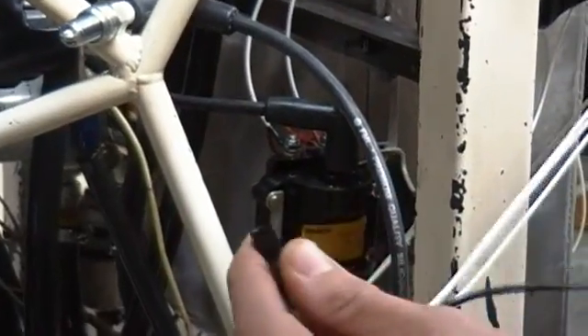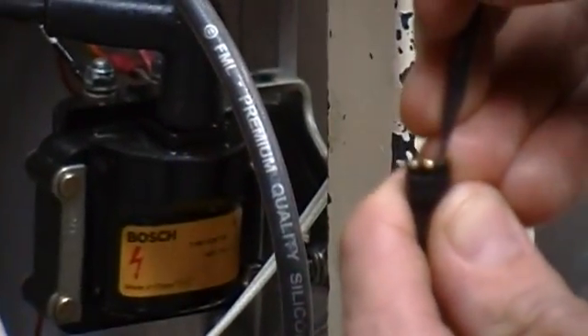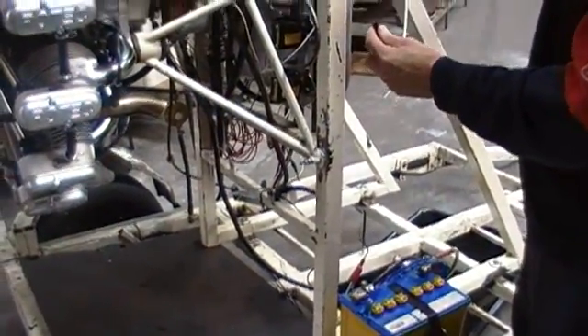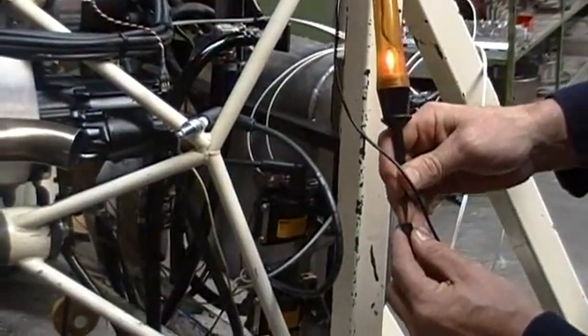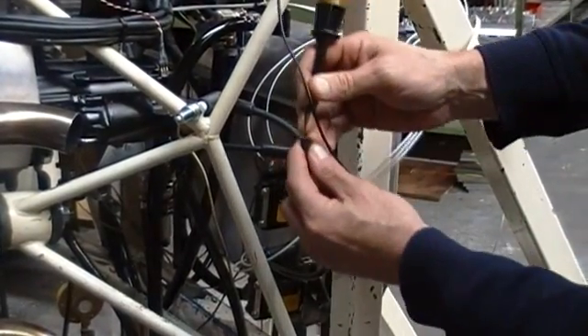We should have the same 12 volts here. Now if we move the test light over to a positive base — which means whenever I touch the test light to earth it's going to light — we should have an earth on the outside pin, furthest away from the groove pin. And there's the earth. So with the test light back to ground: the middle wire is 12 volts power, and the outside wire is the pulse wire — whenever that's touched to ground, it will spark.